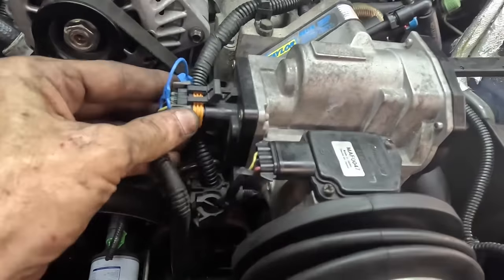the cleaner solution. We'll fill the radiator up with that first. We're gonna go ahead and back this out, fill it full of water, run it, and then service this cooling system. We'll re-drain it again, see what drained out of it, and then we can take a look and see exactly how much oil that stuff removed from the system. Now, they don't claim that it removes oil, that it's specifically for that, but we're gonna see what it does in a worst case scenario.